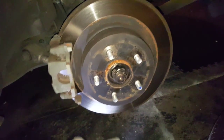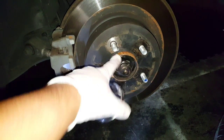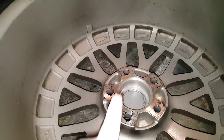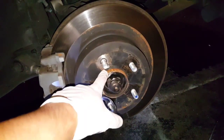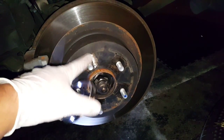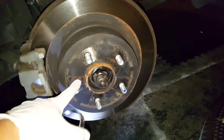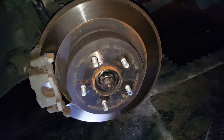The reason why you may be getting that is because your hub ring here is a certain size, so your stock rim sits on that and then your rims will lock into place with your lugs. Now if your new rims have a bigger bore size, that's not gonna sit right on the hub ring, so it's gonna be a little loose. It'll hang down a little bit lower, so really it's sitting on your lugs, carrying all the weight. Since your rim is not centered, you'll get a lot of vibration.